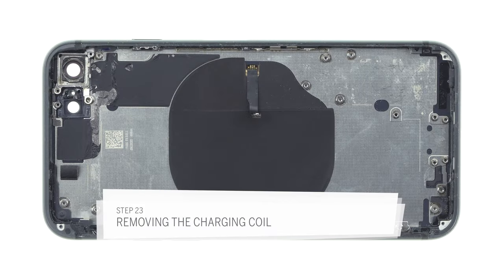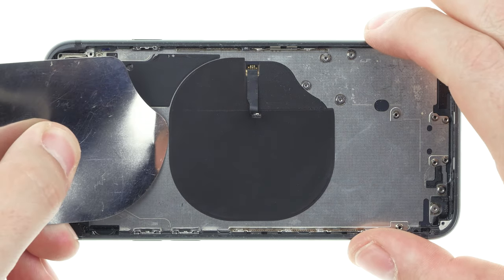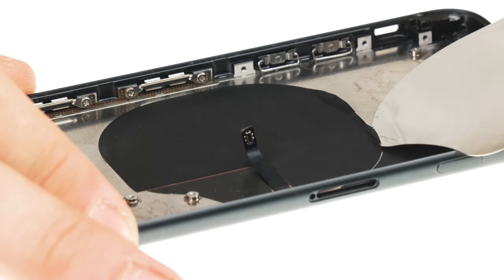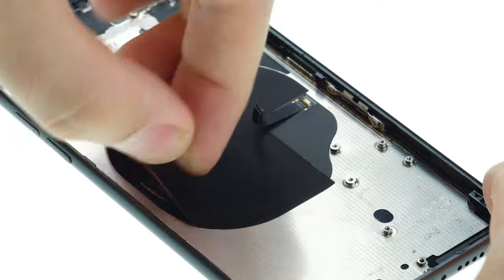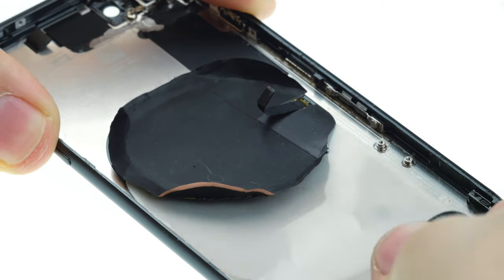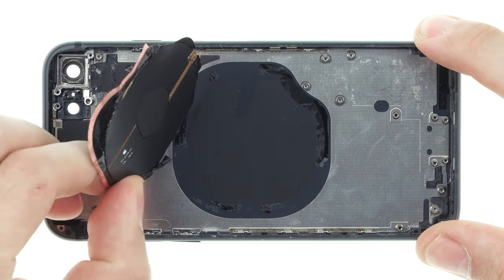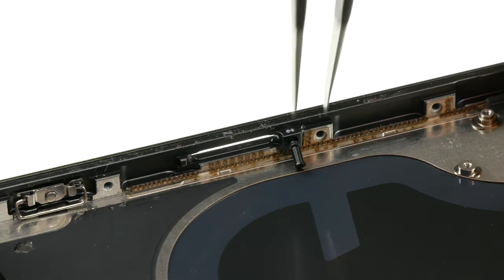You have to reuse the wireless charging coil. This video shows you the procedure for the iPhone 8, and it works just the same for the iPhone 8 Plus. This part consists of a big sticker with a copper coil in it. The sticker is glued around the edges. First heat the edges and then run a flat tool around the whole coil. If you're throwing away the old back cover, you don't need to worry about scratching. Otherwise use a plastic tool because the paint is right under the coil. Once the edges of the coil are released, slide your tool all the way under the coil. If it doesn't come out easily, heat again. Don't forget the small plastic pin of the SIM holder — push it in from the outside and then remove it.